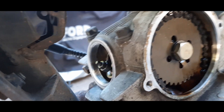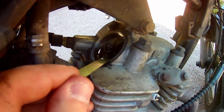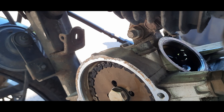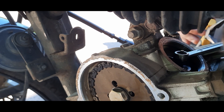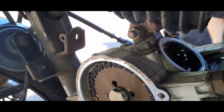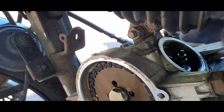Now we need to repeat this process on the intake valve, bearing in mind the intake valve clearance specifications are slightly different to the exhaust. My intake valve was actually at 0.13mm, which means I need to reduce the clearance between the rocker arm screw and the valve top. To do this you'll need your correct feeler gauge, the 8mm wrench, and your long nose pliers. First, place the wrench onto the lock bolt which is fastened tight on top of the rocker arm, then pinch the small square top of the rocker arm screw with the pliers.